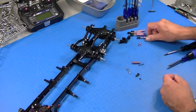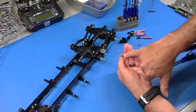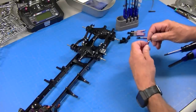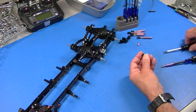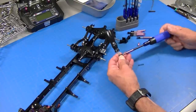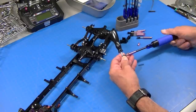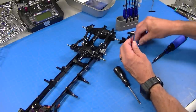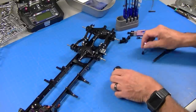The spring dampers are really pretty straightforward to put together. A little plastic spacer drops on the shaft, and the shaft has a Phillips screw head. So you just drop it through, put a screwdriver in there, then put another screwdriver through the hole on the bottom and screw it together — really pretty easy. There are two different color springs in the package; these use the black springs. The top just threads on.